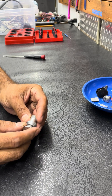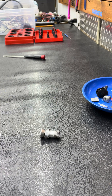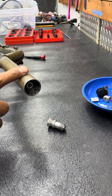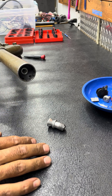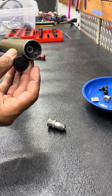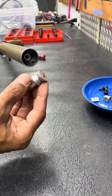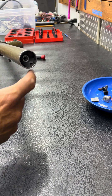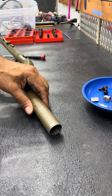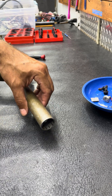This is a compression plug for a carbon steer tube. The alternative would be a star nut, which goes in the steer tube of a fork. For steel or aluminum forks you use a star nut — it's a little barbed hook-style piece that gets hammered inside and sits a few millimeters in, and that's what your top cap screw grabs to make a headset adjustment. The compression plug displaces pressure more evenly around a carbon steer tube so we don't harm it — the steel star nut would expand and put pressure on the carbon, and carbon is strong but it's not meant to implode or explode.